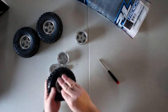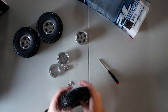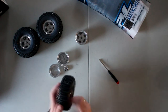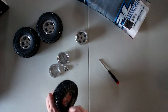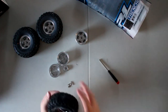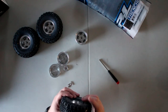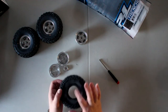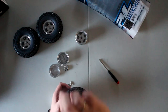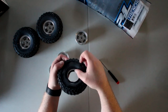Take your center ring and insert it into the tire itself. Just play with it to make sure it is seated inside. You'll see the ring has a kind of a bead all around, and you want the bead of your tire to lay in it.